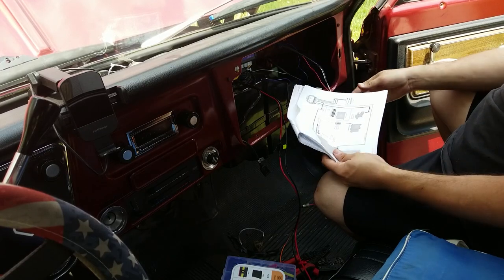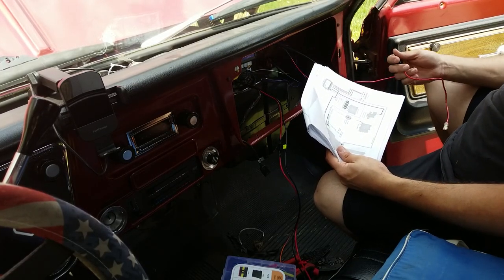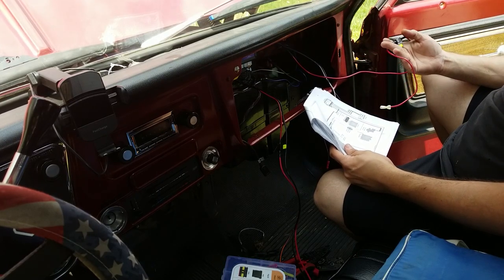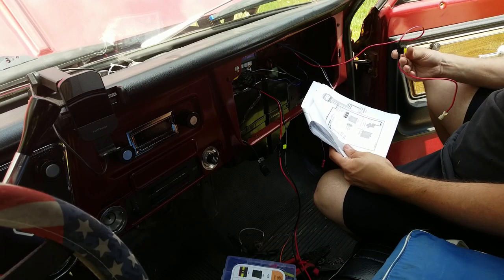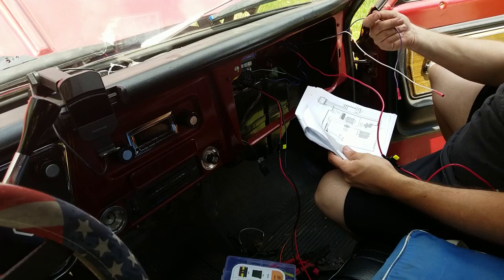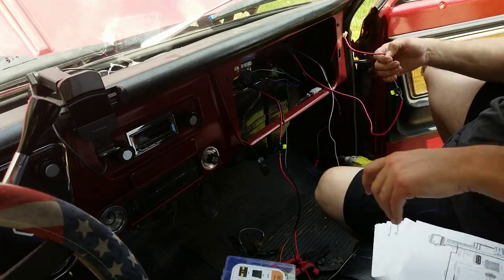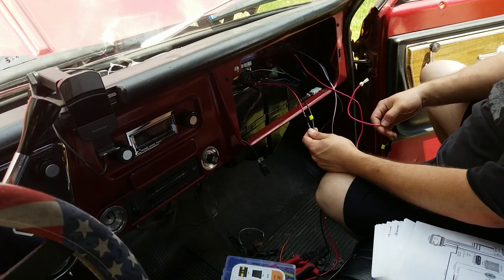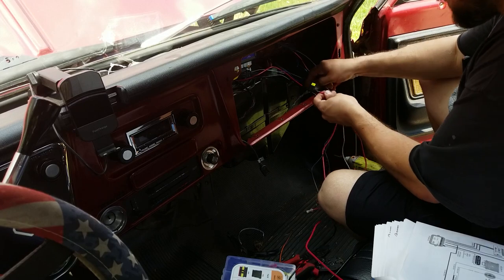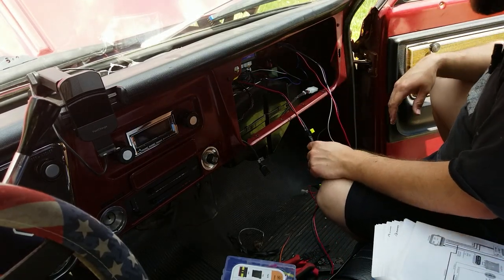See, that's all documented here in this single page diagram. Nope, sure isn't. So this 12 volt power then is just power to run the AC compressor. It has its own 20 amp fuse and a wire that is not capable of carrying 20 amps out to the air conditioner compressor. So that's way oversized. And then this has a 20 amp fuse also, and it's the main power, which includes the blower motor, which actually, okay, it's the same size wire at least. So that's good.